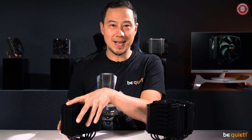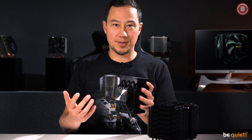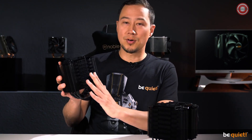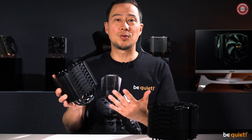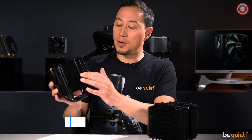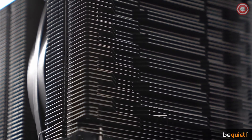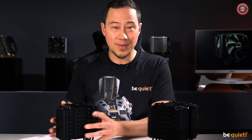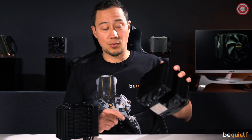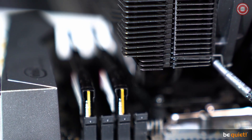Let's go into the details. The new cooler fins are embossed throughout in order to increase the cooling surface. At the same time, they are wave-contoured, which again is not just for the looks. We tried a number of shapes and layouts until we finally developed this form that uses air swirlings for additional cooling while minimizing noise emission. One additional detail with the Dark Rock Pro 4: a small gap in the cooling fins offers more room for the RAM bar.